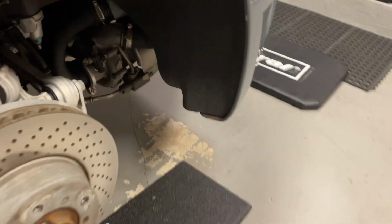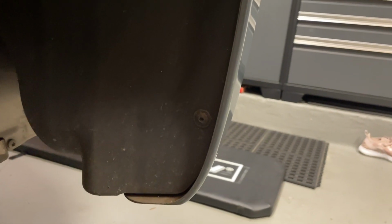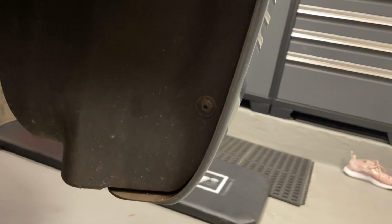So again, to get things started, I removed the wheels because I wanted to have easy access to all the screws I was going to have to remove. And I thought there was going to be three or four of these Torx screws that I was going to have to remove, but I'm only finding two under here. There's one right there and another one right there. These are T25s, and then underneath the vehicle